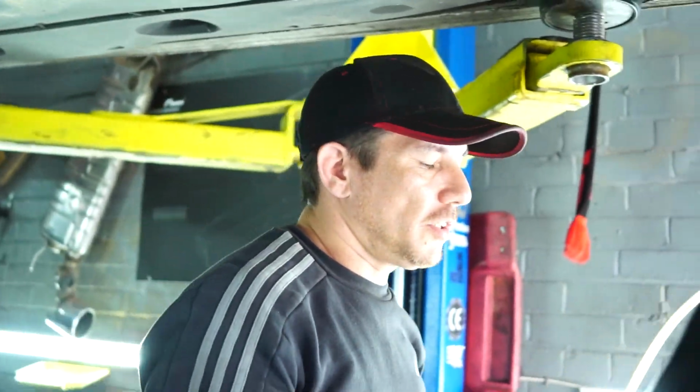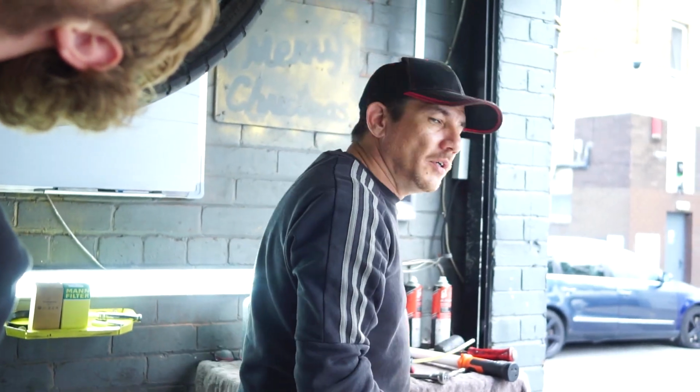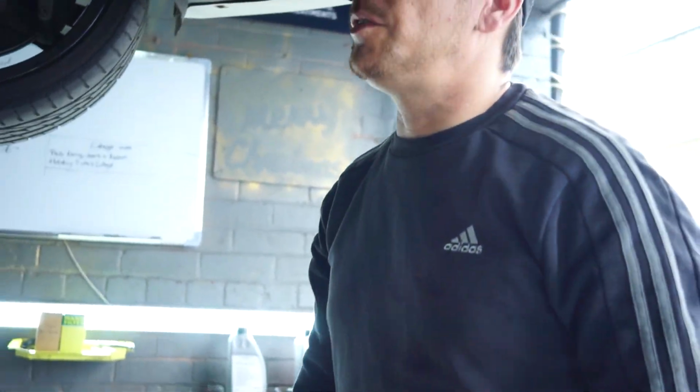That took actually around about 50 mil, maybe more, of additional oil. So always make sure that once you've actuated the clutch pump, you go in and you fill it again, because there will be a void in there, as I say, and you've just seen that now. You need to make sure that you perform that second fill. That goes with all the Haldexes, bar I think the Gen 1, where you've got to be really quick.